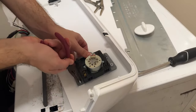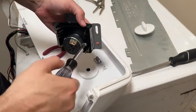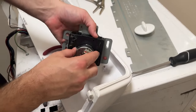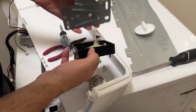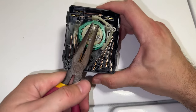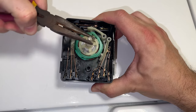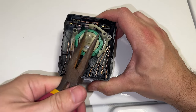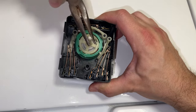Onto the timer — you can squeeze down on the tabs with a pair of pliers and it should release. The timer has two Phillips head screws that hold it all together — I just removed both. It was pretty interesting to see what the inside looks like. I'd always assumed there was some crazy electronic stuff behind this knob, but instead the entire thing works based on a wheel in the center turning and causing different contacts to open or close based on position, which gives the dryer its different settings. Kind of a neat part.